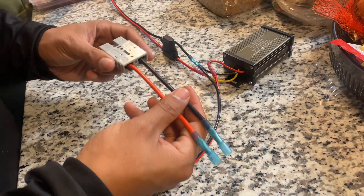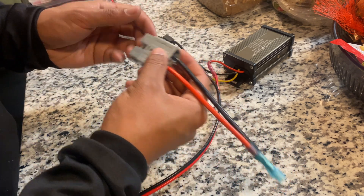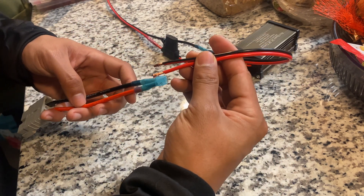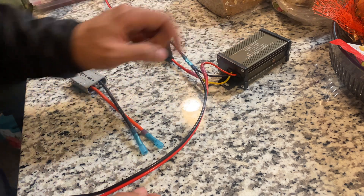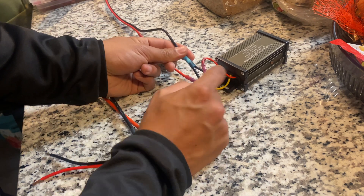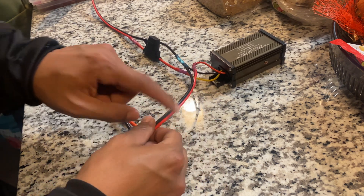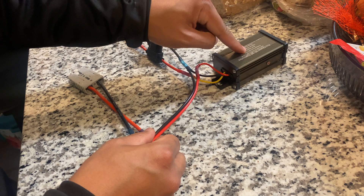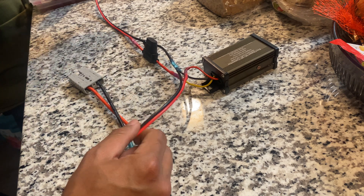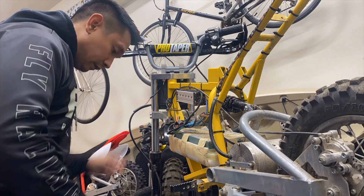I'm just going to quickly go over what we just did here — it's much simpler than it looks. This is just the power wire that we unplugged from the battery; this is what was supplying power to the controller. We're just going to be teeing off of it to supply power and ground to the step-down converter. This ground wire actually goes all the way to the headlight — I just have the ground from the converter teed into it. This power wire is supplying 52 volts to the red wire going into the converter, and then the yellow wire coming out of the converter is feeding 12 volts to the headlight. And I just have a 10 amp inline fuse hooked up to that wire.